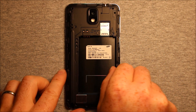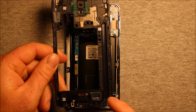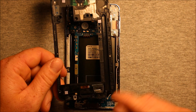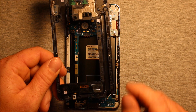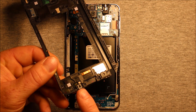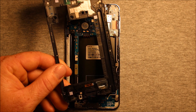What we're going to be replacing is the speaker assembly, which is right here on this bottom part. It's really hard to change this just by itself, so what we have to do is change this whole back cover — it's really not that expensive. Just make sure that the one you get has this rubber part for the microphone down here. If not, you have to swap it out — just use tweezers, stick them in this hole right here and it just pops right out and pops back in.